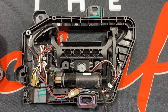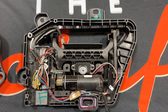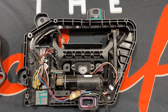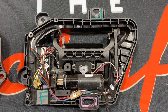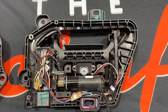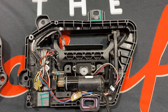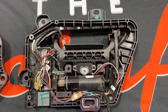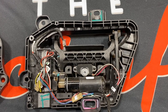Here we have a Gen 2.5 handle. These had a new handle housing but the same design for the microswitches and paddle gear. The main benefit was that the handle housing was no longer specific to front or rear doors — it was now only side-specific from left to right. The door shell's mounting studs physically changed to accommodate the new style handle. If an older car has a door replaced, it needs to be updated to the newer handle housing, as the 2.0 version will not bolt up to the newer style doors.